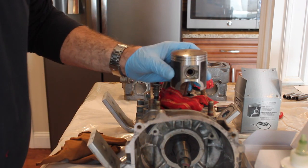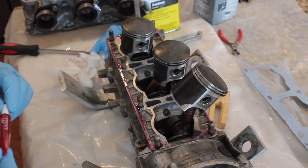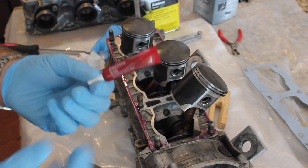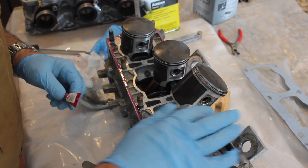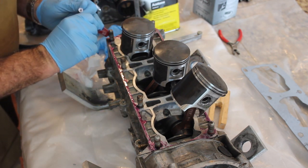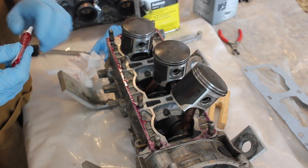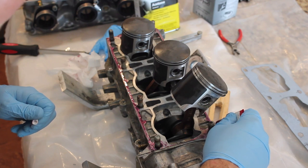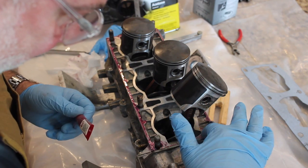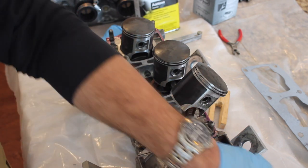That's how you install a piston. Now preparing to put the cylinder head on. I'm preparing the case — before I put the gasket on, the manual says to use some Loctite 515 on the ends of the case. The last time we put this together we didn't do this and we got some radiator fluid leaking out of the case, which meant it had to go back to the dealer. I've watched a bunch of videos and read a bunch of things — people's advice isn't consistent — but I'm going ahead and doing it.